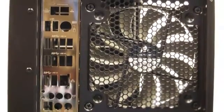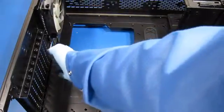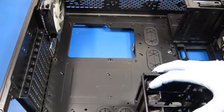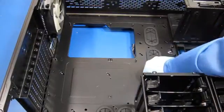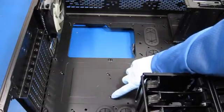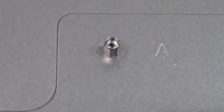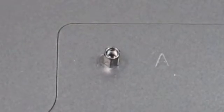You can see when the panel's in place it looks kind of like that. Now that we have the chassis plate installed, there are standoffs here, here, here — several of them — and one you can't see because of the hard drive chassis. The idea is that the motherboard sits on these standoffs. In reviews they mentioned bumps, but these actually look like built-in standoffs. We're going to pop the motherboard on and see how that looks. The close-up illustrates there are no longer bumps in this design — they must have modified it. It looks like a much better approach.